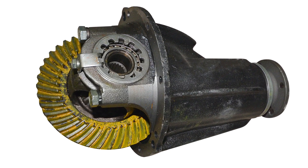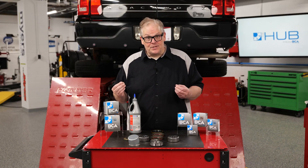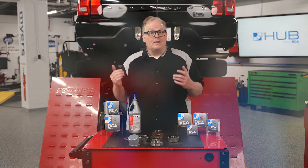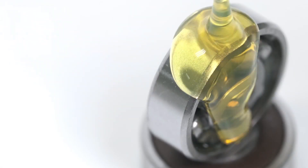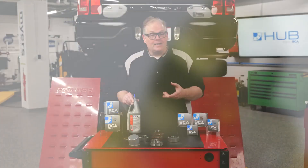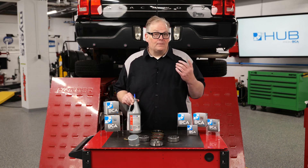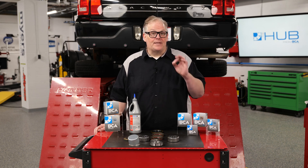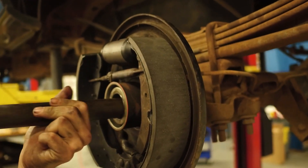No matter the type of axle, it is critical that the surfaces are free from corrosion and damage so the seal can operate as intended. Before installing the axle and seal, use a fine grade emery cloth to clean contaminants and debris from the axle shaft and inner housing, as debris may prevent new bearings from seating properly. Lubricate the replacement bearings and seal before installing — you can do this by submerging the bearing in oil. Install the bearing inside the axle housing with the seal facing outward until fully seated, applying pressure only to the outer diameter of the bearing, not the seal. Reinstall the axles and complete assembly per the manufacturer's recommendations.